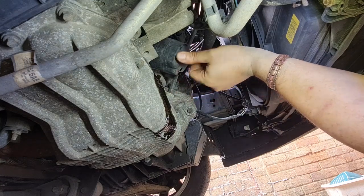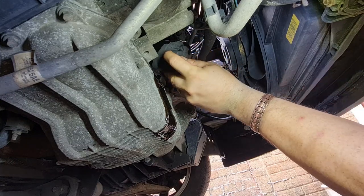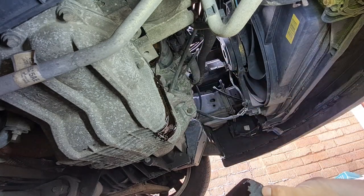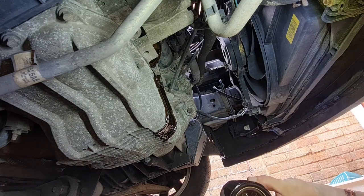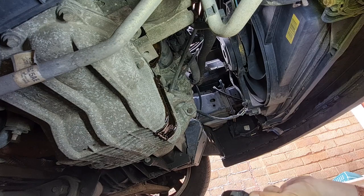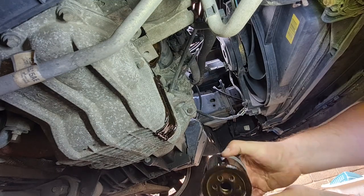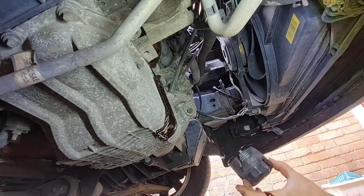What I did when I did the oil drain - because it had not been done for a long while - was I actually left the drain plug out and poured a little bit of new oil that I had in the garage already through the engine, to drain out any manky bits at the bottom. Not that there really were any, but I thought the cleanest I can get it is the best it can be. So it did actually end up draining out clean, which is good.